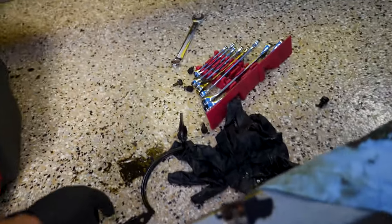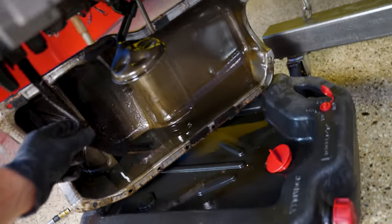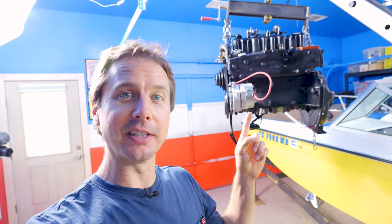I've already got some emery cloth in different grits. We're going to sand down that journal on the crank, throw an old rod bearing in, and we're going to be back up and running — maybe. All it should cost us is an oil pan gasket, because in my haste ripping the oil pan off yesterday, I tore the gasket. Disclaimer: this is not good engine advice. If this was your boat, you should probably take the time to take the crank out and let a machine shop fix it. But if you're a redneck and you're cheap and you want to sand your crank down, definitely do it.